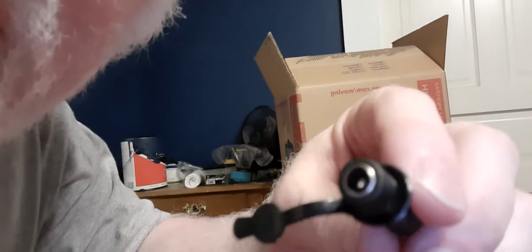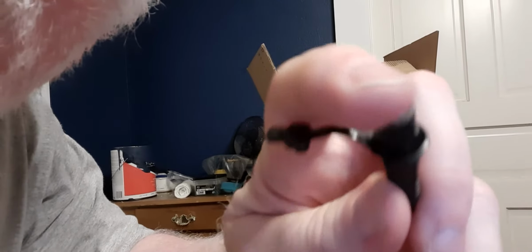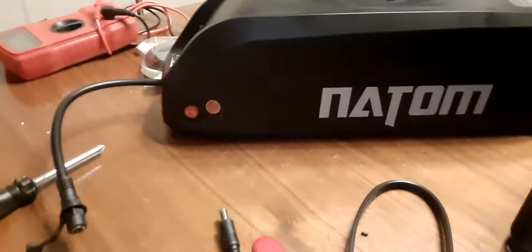This body is usually plastic all the way to the end of this. I'll show you what I mean. Let me unplug this thing. On this is the pigtail I wired into the top of this thing to replace that port. But even on this, you see there's a little bit poking out. But in most equipment, this is all shielded in plastic, so you don't ever have the ability to touch that with a metal object and join the two connections. So yeah, it's kind of a shitty repair, but hey, it's going to work. That wire's in there so tight that water can't get in.